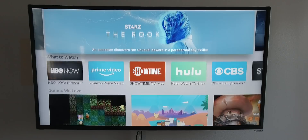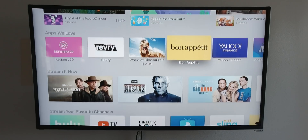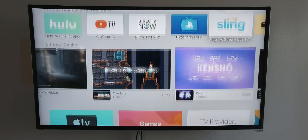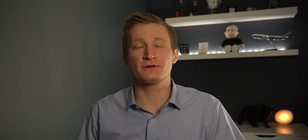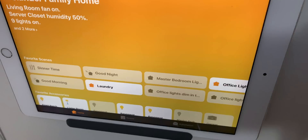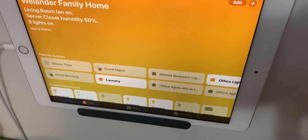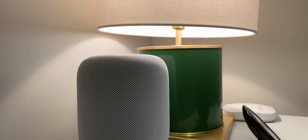So what device can you and should you use for your HomeKit hub? Apple allows you to use an Apple TV — basically any of the ones with the App Store. If you have the App Store on your Apple TV and can install other apps, that one can also be a HomeKit hub. You can also use an iPad, although Apple recommends it be regularly connected to power and never really leave the home in order to be a reliable hub. It should also stay in the same place more or less. Make sure it can run the latest version of iOS — if your iPad can't run iOS 13, I don't think it's a good idea to make it your HomeKit hub.